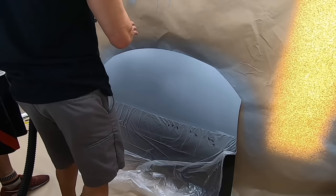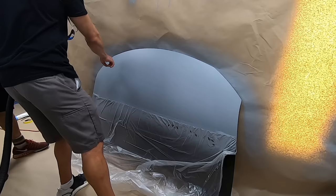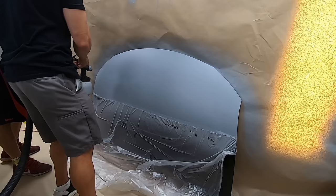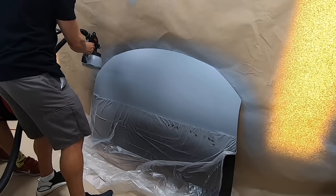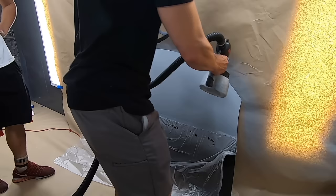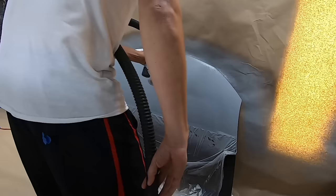You're going to try to tighten up that overlap. You're gonna pay attention to where the bottom of your spray fan is, and that's gonna be your center line for your next pass. The bottom of your spray fan, center line for your next pass. That way we make sure we get those tight 50-50 overlaps. And on this one, let's make sure we avoid that angle. You don't wanna be out here or out here on the edges. I wanna encourage you to walk a little bit more, walk yourself just to make sure that the gun is staying perpendicular to the spray surface. Cool? Yes, sir.